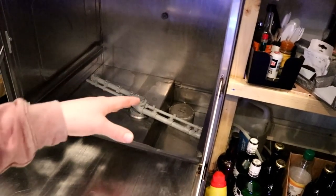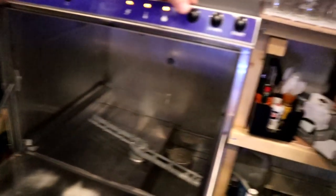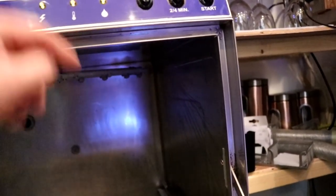At the same time it will pump a little bit of water out, giving you a constant turnover of water in the glass washer so you don't have to manually drain. But at the end of the night we normally drain the glass washer - there's a power button, so that's the drain button. So you can hear that. Looking at that, there's a little air vent pipe in that top corner there. If you press the button you can see it squirting out, so that's telling me there's definitely a blockage between the pump and the exit. The exit pipe comes down here - you can just about see it. There might be a blockage on that pipe section, so we'll zip it off and have a look. Because it's pumping out quite firmly, that's telling me the pump is working, so I think the blockage is further down the line.